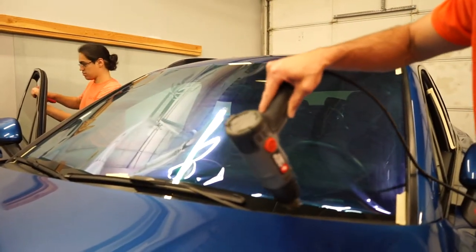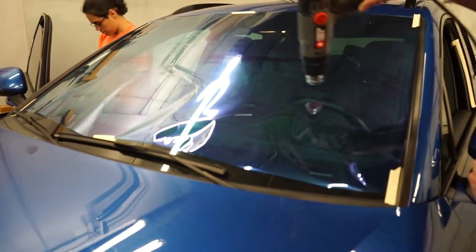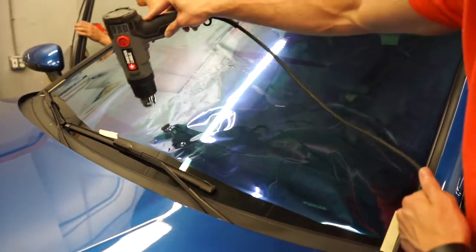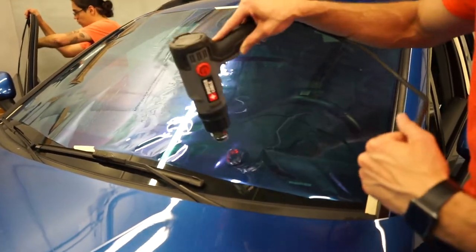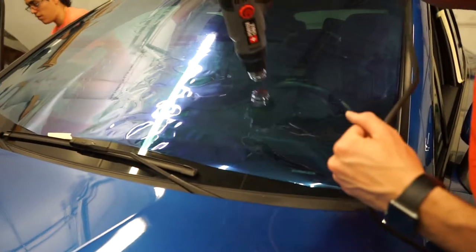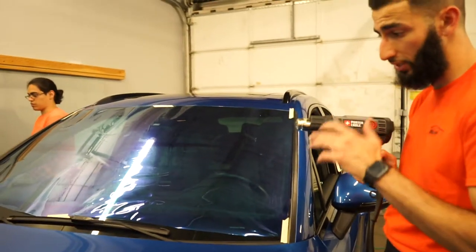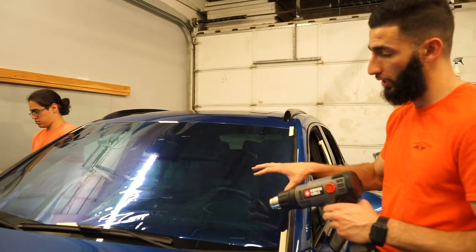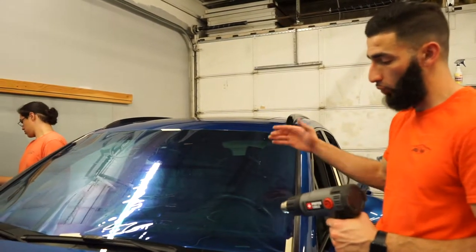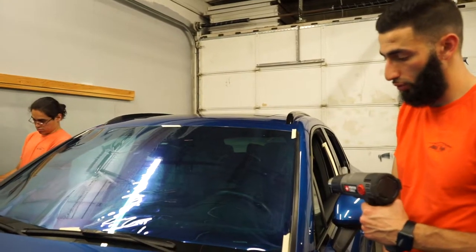As you can see, it started to flutter and it started to close on itself. So now I'm going to start heating it up, going in a circular motion, making sure I get everything from top to bottom. Then you're going to want to let the film sit for about 10 seconds or so and let it cool off. The film is actually going to shrink itself just because there's a lot of hot air underneath — all that film is going to kind of settle. And then once that settles, you can use either a card, a squeegee, or I like to use my forearm just because it's a little bit bigger.